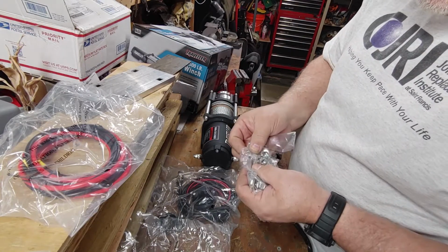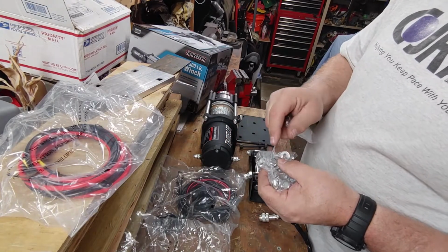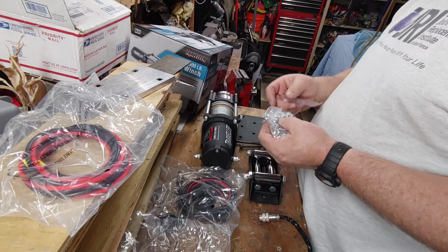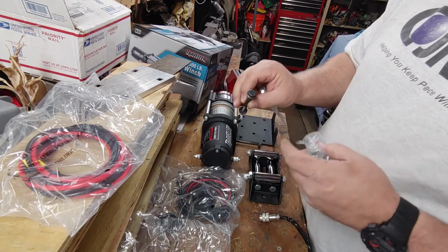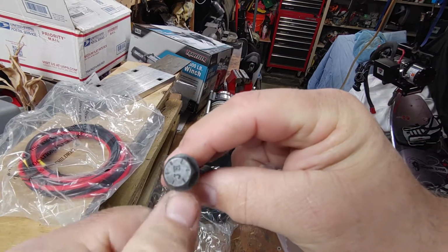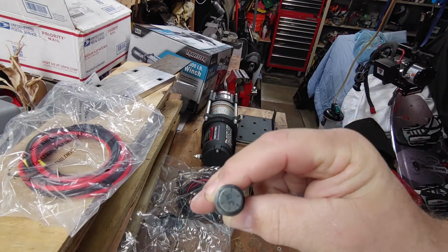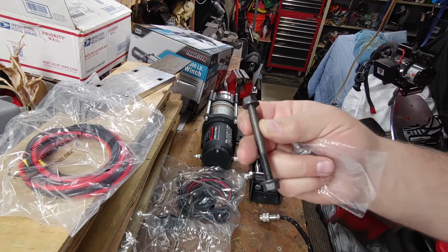Looking at the back of the bolts, when a bolt is hardened, it will have lines on it, like a grade 8 or a grade 5. Like here. This is a grade 5. See the little speck marks here on each corner? That's representing the hardness of this bolt. I know this is a grade 5.